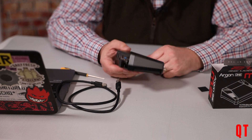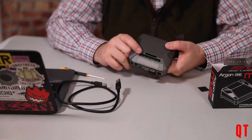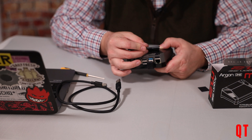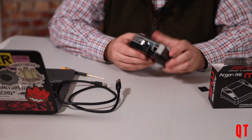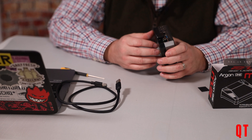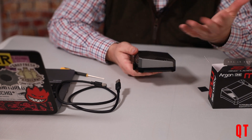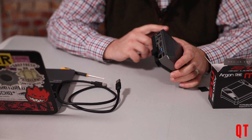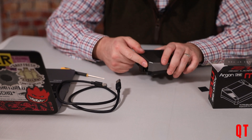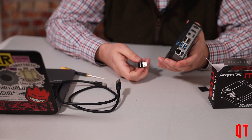The GPIO ports are really cool — they're labelled and coloured underneath this little magnetically-held top bit. I really rate these cases. They are expensive — around 40-something euros — but they're so flexible. Wi-Fi seems to work okay despite the aluminium case. The whole top part of the case acts as a heatsink, and there's even a fan. The controller will turn the fan on if it gets above 60 degrees, 80 degrees, et cetera, and you can control that. You've got your power button on the side, and I changed it to always-on since this is going to be a server.